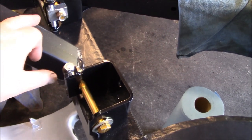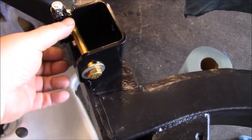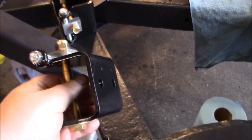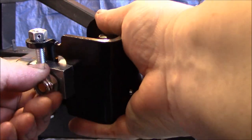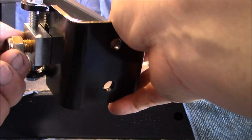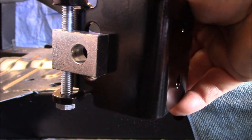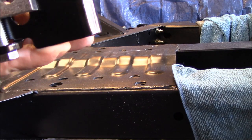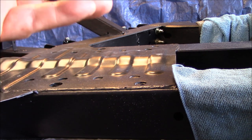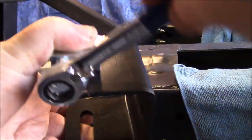The next step: Richard says the adjuster on the inner bracket should be set fully down, and the adjuster on the outside bracket should be set in the middle. I'm not going to touch the outer bracket - it's relatively centered at the moment - but we are going to move the inner one all the way down. To adjust the inner bracket down, I remove the pivot bolt, set it aside remembering which way it came out, then use a half-inch wrench and crank it until the adjuster bottoms out.